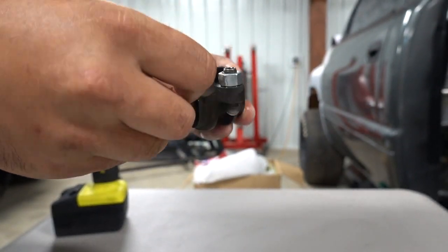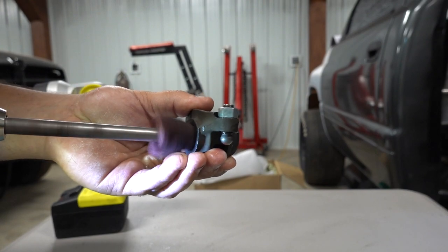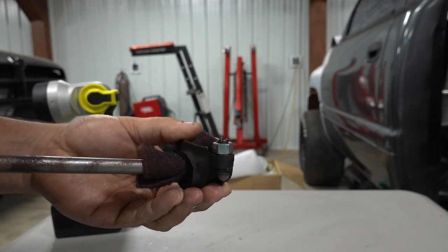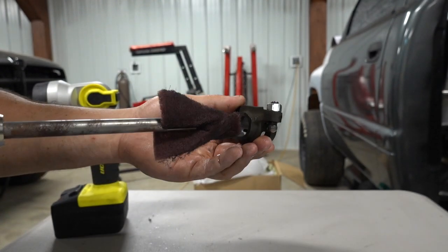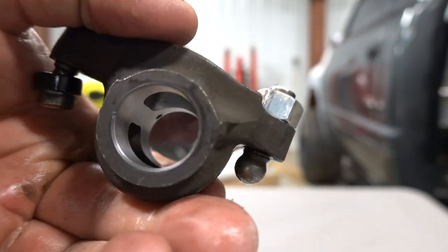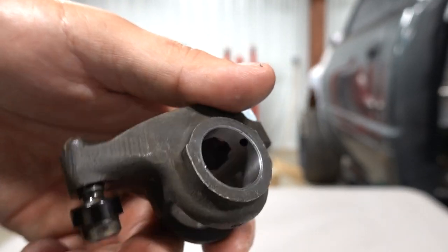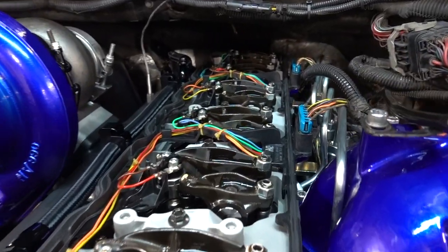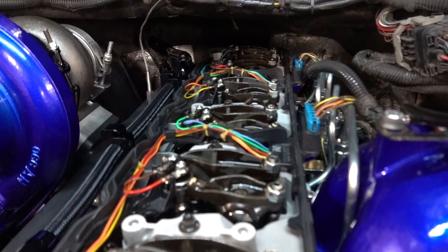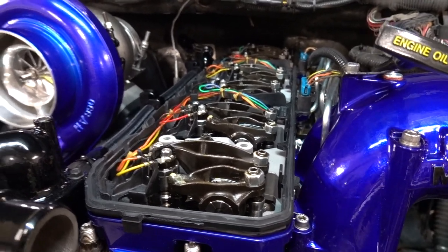Stick that in just like so, hit your drill just like that. All right, now we've got a nice smooth surface in there - make sure you guys clean these out extremely well. That should do the trick - that should free us up. Make sure you've got your oiling holes clear. We are back together and ready to fire this thing up. Everything is lubed up, got a whole bunch of Amsoil assembly lube up in there, rockers are good, everything is torqued down. Rotated over by hand multiple times checking the clearance - everything looks good.